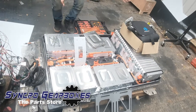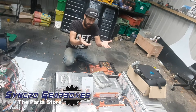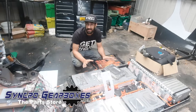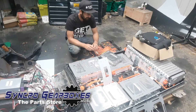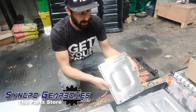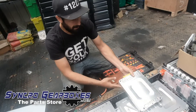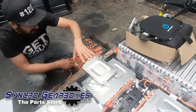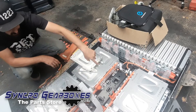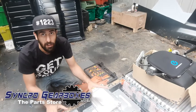This is the battery pack out of the Nissan Leaf — this whole thing literally sits under the floor of the Nissan Leaf. Year-wise this is like 2017, something like that. The battery pack is made up of all these modules — this is one module here, kind of laptop size, a bit smaller perhaps. There are 48 modules in total: 24 in the back and 24 in the front, and I think it's something like 380 volts that this gives us.